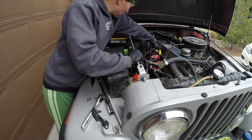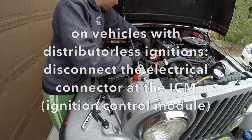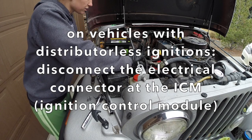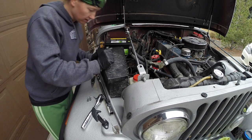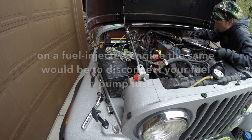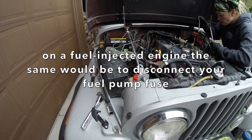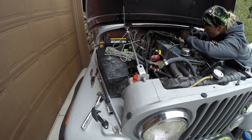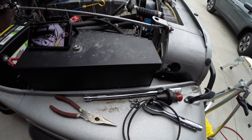The other part is to disable the ignition system. So I'm removing the plug from my coil and then we're supposed to ground it out on the engine — I think I'm going to have to use an alligator clip and jimmy rig something. It also says to block the throttle and choke valve. This is my remote starter that I'm going to use to make it easier for me to read my own compression test.